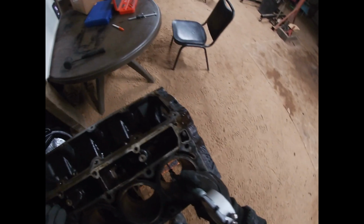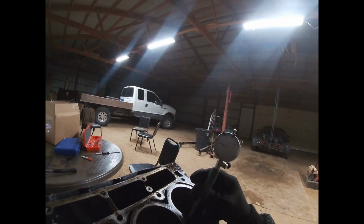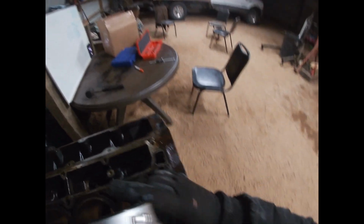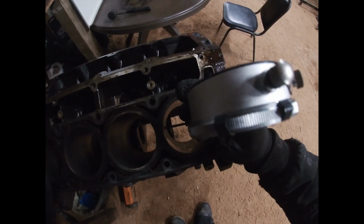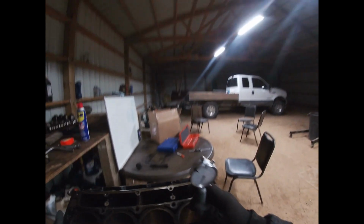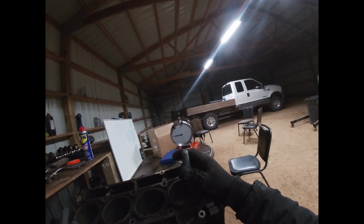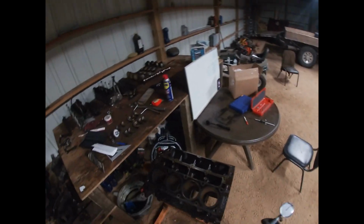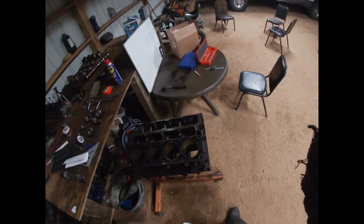Let's go right down to the bottom of the cylinder here. And that's showing the same. It's showing me 779 all the way down. And now we can see down in the cylinder where the piston stops right there. So there I was measuring the skirt as it goes all the way to the bottom of the cylinder. Now we measure the other side of the piston and it's 779 again. So we're getting 779 throughout the entire cylinder, which is to me bizarre because there doesn't seem to be any taper. But this is the first LS I've ever worked on. That could be a thing.